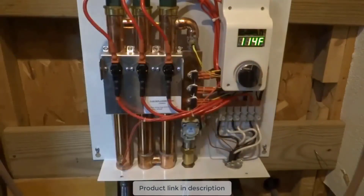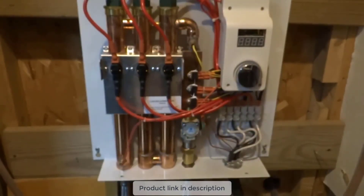It doesn't take up much room, and I just wanted to share my experience after going on six years with no real issues. Some people in the comments have noted that if you don't have good clean water, you can get scale build-up on the heater units — those are actually on top and are replaceable. You can disconnect the power, unscrew them, pull them out, and get replacements at places like Home Depot. My units have been going strong with no loss of heat. I have fully treated water — filters, salt tank, the works — so I've never had any build-up issues. But if your water isn't clean, scale can build up and the heating units may need to be cleaned or replaced.